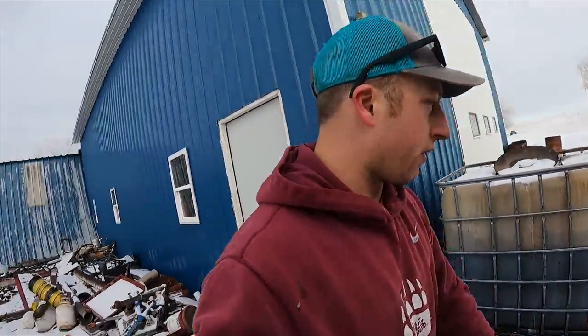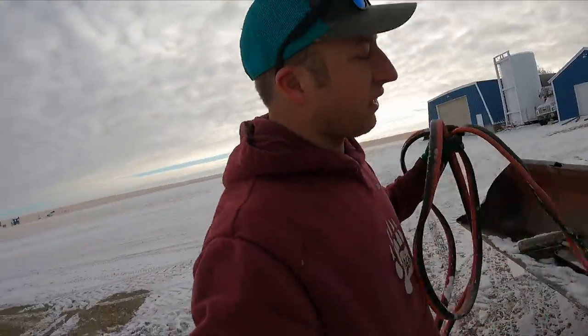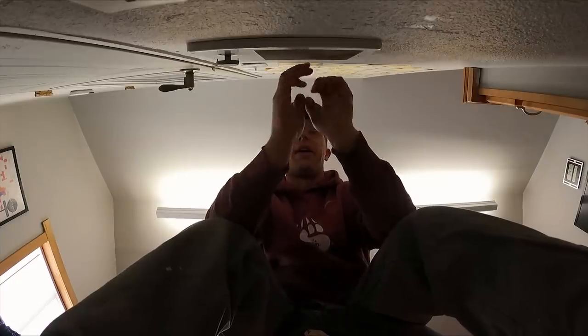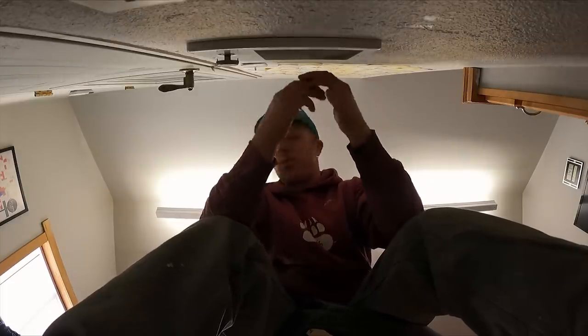It's been giving us trouble for a while now. We've read all the wiring on that thing from the grounds to the leads. It's got three batteries and they all had good voltage. Yeah, it's got to be the starter. Time to warm these hands up — I've got weak hands. I'm going to put my warmer gear on; I've got some refrigerator gear right over here.